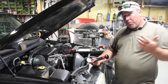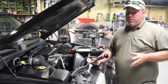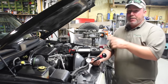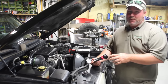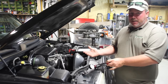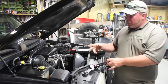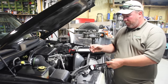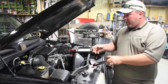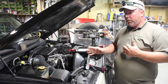What if you pump it up, the pressure is going down, but you can't see a leak? That's probably one of the worst-case scenarios. It could be as simple as a blown heater core leaking into the interior of your car — check the floorboard inside. Or it could be a blown head gasket where coolant is leaking into the engine and burning off, going out the tailpipe. Normally you'd see white smoke prior to that if it was a significant leak, but if that were the case, you could literally be pumping water into your engine right then. Another possibility is a failed oil-and-water cooler or a blown intake gasket where coolant is going into the oil system.